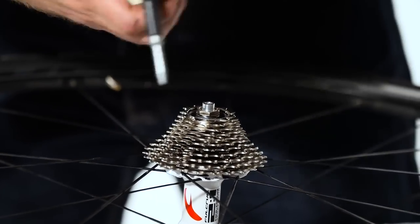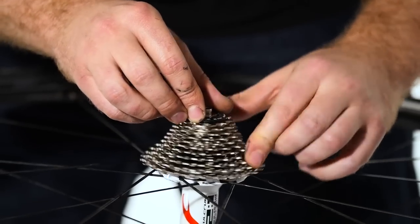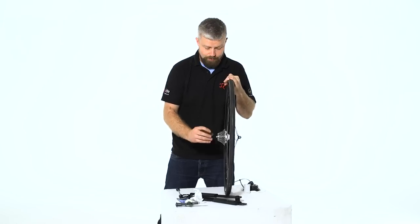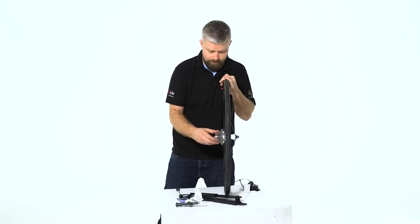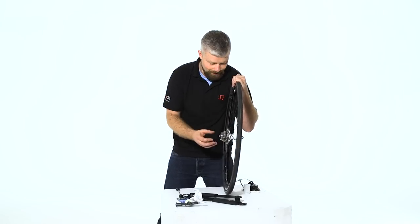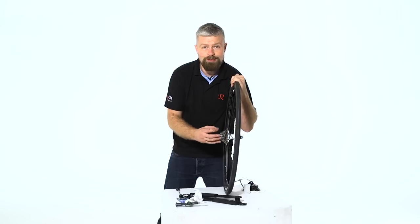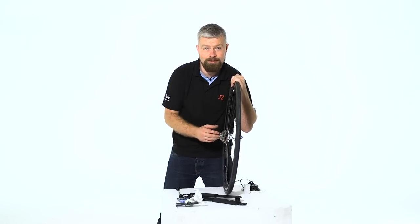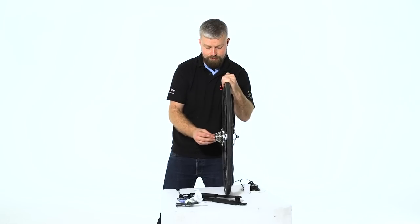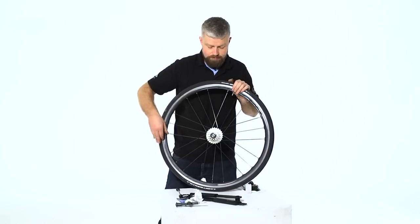With a little bit of grease on the threads, you can tighten the lock ring into place. Always nip it up by hand to start with. Before you get the tool out and really crank down on the lock ring, just make sure that everything is as it should be. If you failed to put them on using the new plastic carrier, just make sure the sprockets are all aligned correctly. Check that everything is seated properly — especially the final sprocket — because if you haven't quite got it online, it can still be possible to tighten up the lock ring and you could damage something. Give it a spin; if it all looks good, then we're ready to tighten the lock ring.